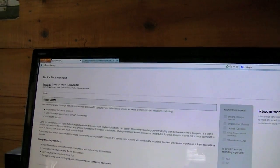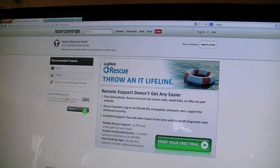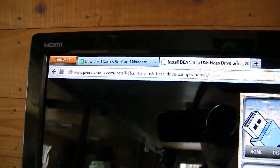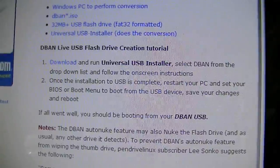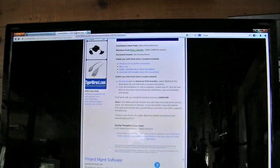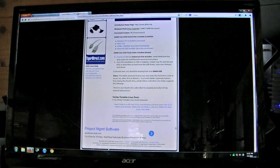When you go to download it, the file is not that big. The latest version for CD and DVD media is not very large. If you want to load it onto a USB, just download that file — I think it's around 19 megabytes. You can find instructions by typing in the address or by Googling 'DBAN USB'. You download the USB installer, download DBAN for CD and DVD, tell it where that file is, tell it what flash drive you want to load it onto, and when it loads you can boot off of it.